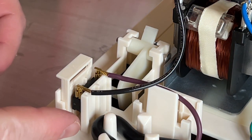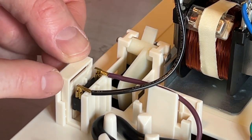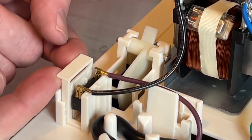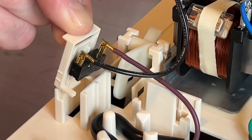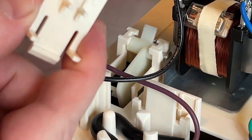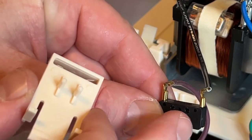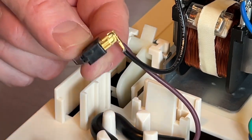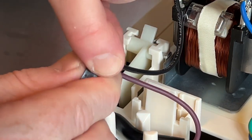Even better, go back with your voltage tester and make sure there's no current running to the machine before touching anything. Once you've ensured that there's no power running to the pump, we can go ahead and remove the switch. The switch is connected to a plastic housing — that's what we're taking off. We can't just lift it up even though there's a pull tab on it; it needs to be pushed in first. So you push in on the tab and then lift up — it comes right out that way. You can see the switch isn't permanently attached; it sits inside these two pins.